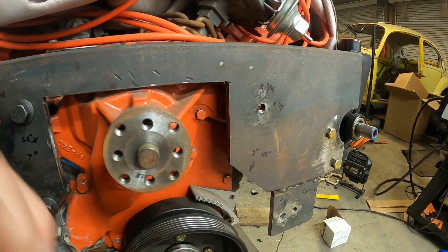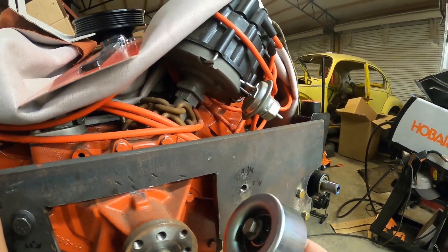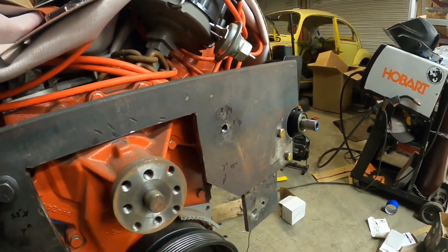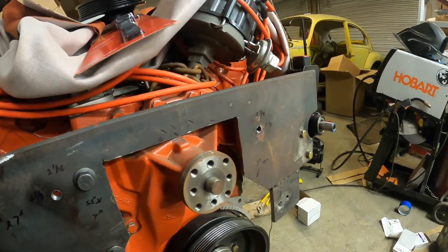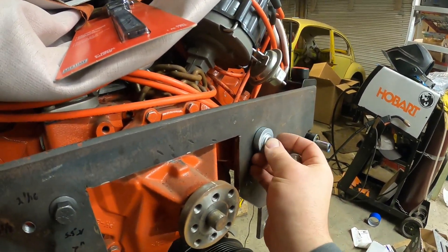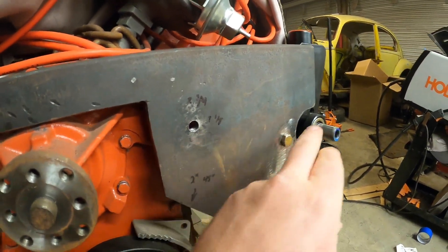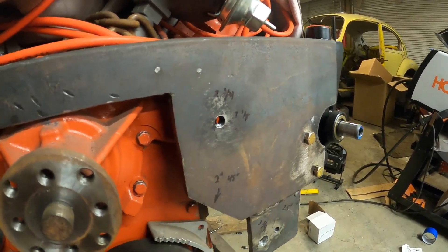This small pulley over here — the part number is a Gates 36173. For the guts of it, I actually pulled the spacer and the bolt out of my bigger pulley that mounts right there — that part number is a Gates 36299. Those gave me the spacing I needed for belt alignment. The smaller pulley is 7-1/8 inches from this edge to the center of the hole and 2-3/4 inches down, though that's approximate since I'm using a tape measure.